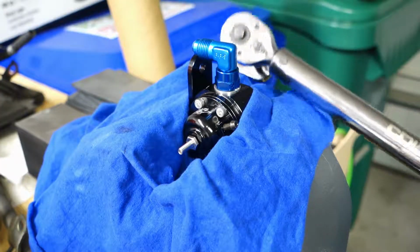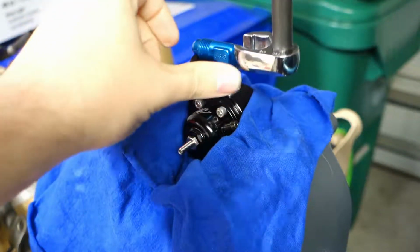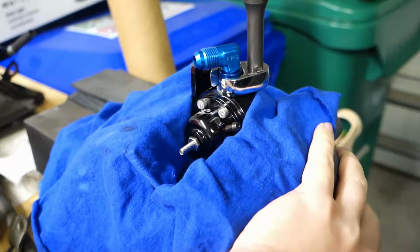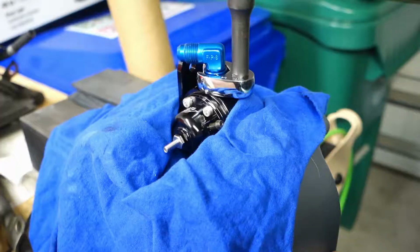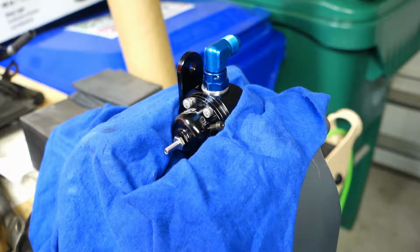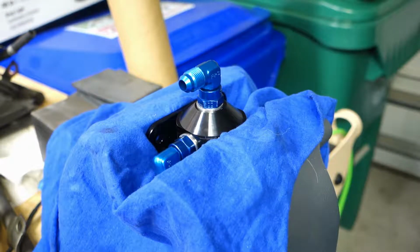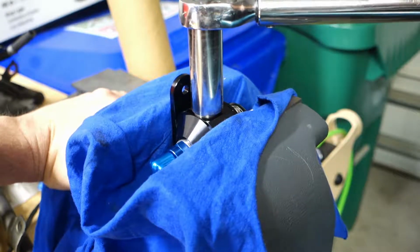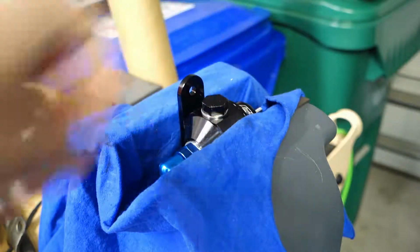All right, so I've got my wrench here. It's basically just my torque wrench set to 19 foot-pounds with a crowfoot on the end of there. So I should be able to slip this over that, down onto here. Oops, my vise isn't bolted down. That is pretty tight. I worry about going any tighter with that. Yeah, that's pretty in there. I don't feel like going any tighter. If it starts leaking or something, I'll snug it up some more, but that is pretty tight. I think that's going to do.